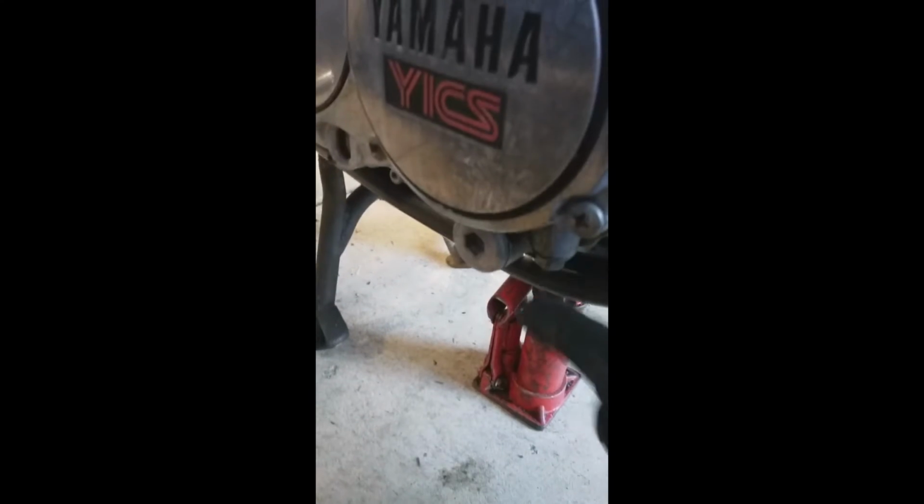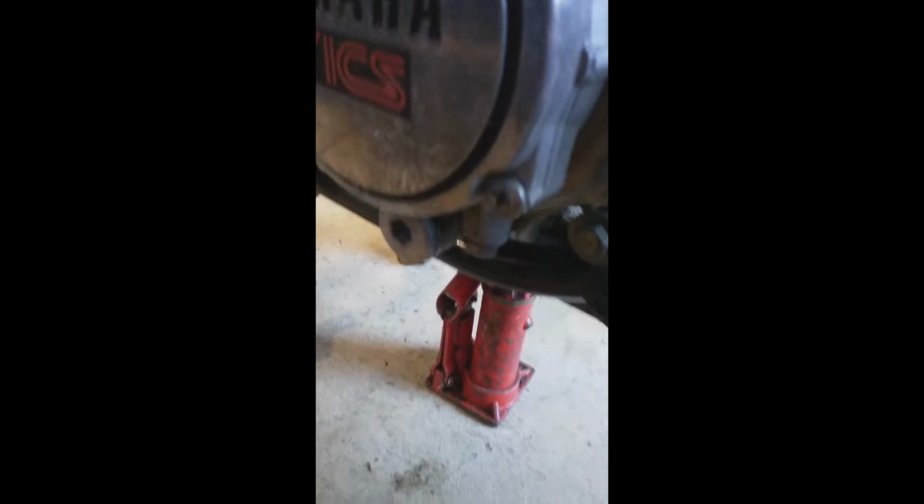Right, so I got the motor braced on the oil pan right now with this piece of plywood. I've only got one more bolt to remove before the engine should break free of its mount. But I think I would need to support it on this before it breaks free. And I still need to see if there's more on the back. I'm gonna reread the instructions in a second and see if we can get it out of here.